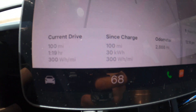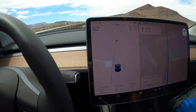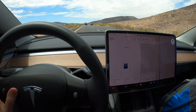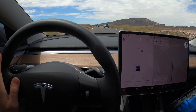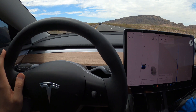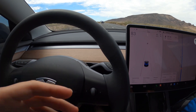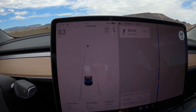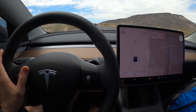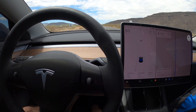Currently driving on the highway at about 80 miles per hour. We just hit 100 miles driven and we are at 48% battery, with the AC set at 67–68°F the entire way. We're on our way to the charging station with 37% left in about 20 miles. So far it's been really accurate and consistent, plus or minus 3–4% accounting for the AC and going above the normal 65 mph speed.